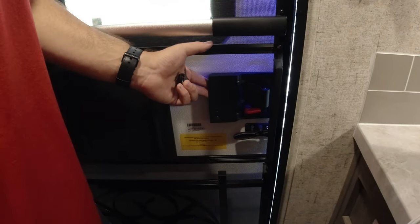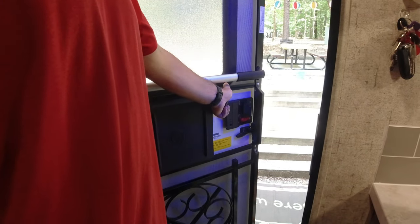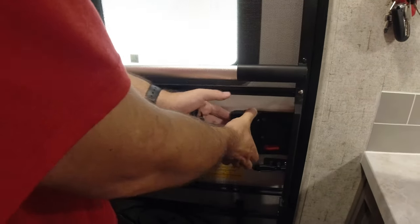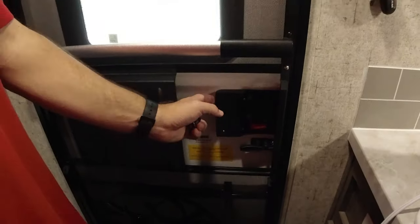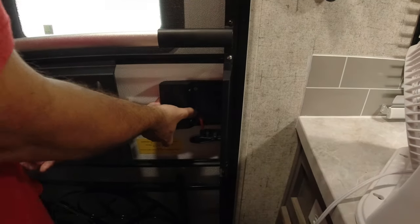You just can't pull it tight from close up — we've got to get a little distance on it. That's all right. And then lock — you're not going anywhere. So now you have to program your new key in for your new code. You hold down the 8th button while simultaneously pressing the lock button, then release both. If you hear a long confirmation beep, you have entered programming mode.